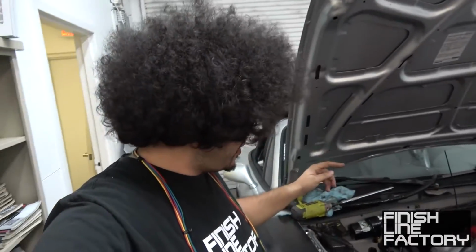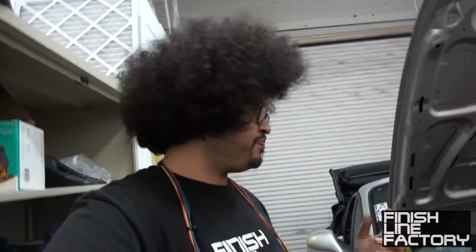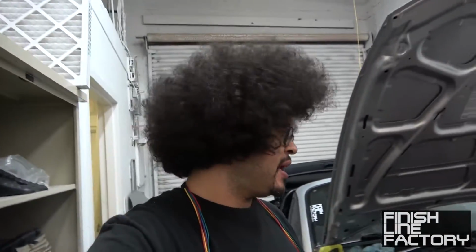And what I did was I took two extensions, because it didn't have a long enough punch, a quarter-inch bit, a quarter-inch socket, and a quarter-inch Phillips head drill bit to make a punch. Put it on the inside and whacked it with a hammer to make a few punches into the other side. Not to penetrate, but just to mark it, right? And then I marked it with a Sharpie and drilled a hole through with my hole saw right here.